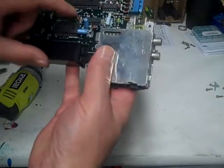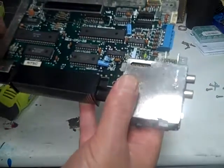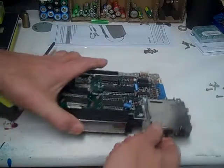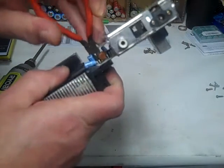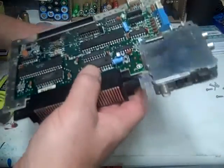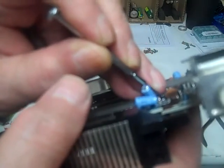The chip we're going to be looking at is this chip right here. What we're going to do is count four pins over and clip that fourth pin however we can. Let me get my little nippers and see if they'll fit in there. That ain't going to work, so I'm going to get out the X-Acto knife. I went ahead and got my clippers in there and clipped it. You can see there's a nice big space in there — that's the one we wanted to clip.